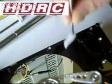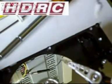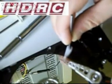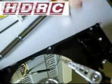So we'll rotate the platter in just a moment. The first thing I want to show you is making sure the wedge is the right distance from the platters. Then we rotate the platter in an anti-clockwise direction, get the head assembly close to the edge of the platter, and test it with your read-write head removal tool. Make sure that the wedges are going to sit comfortably underneath the heads.